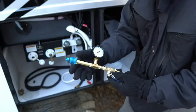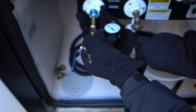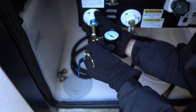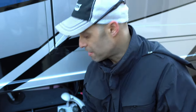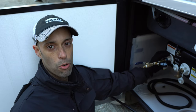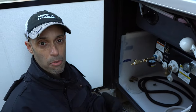Then you're going to put the end of this test plug inside where your freshwater city connection would normally go. Make sure that if you have a valve that allows you to fill your tanks or go to city water, it's set to city. Make sure the connection is tight. What's really important before you run this test is to make sure all your connections are nice and tight, so you don't get any leaks from the actual connection itself.